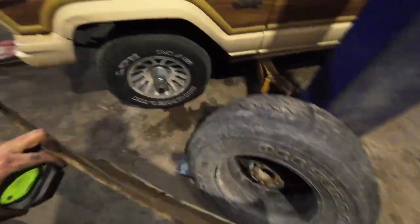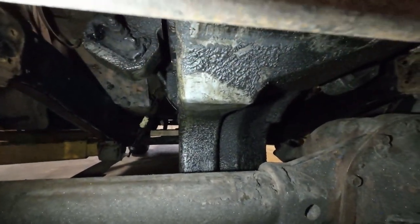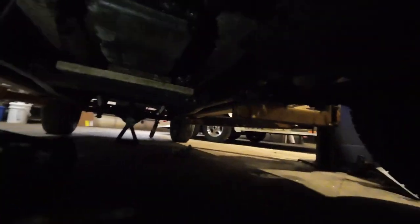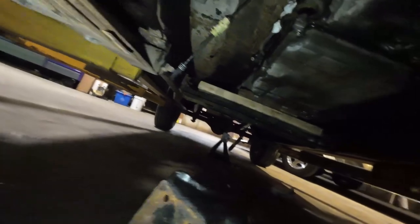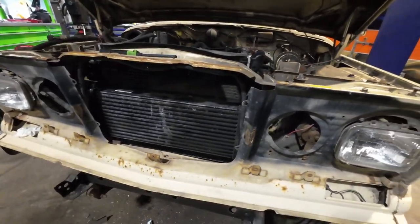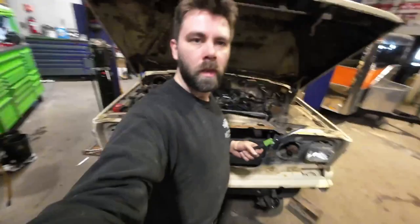Oil pan to diff clearance - you can't ask for anything better than that. There's still tons of room for suspension travel, and we're putting a lift kit in it so we're going to gain even more room. Right now there's two 2x4s stacked on top of each other holding the transmission up on the factory crossmember. We're just test fitting the radiator, intercooler, and AC condenser. I just went and grabbed the steering box to bolt that in and make sure it's not going to hit the rad where I think I want it. There's plenty of room to put an electric fan in there. That's probably going to do it for video updates today - we'll see you guys in the next video.